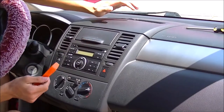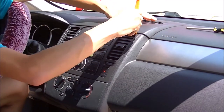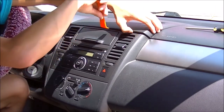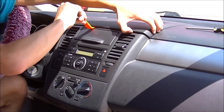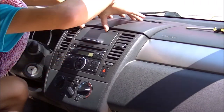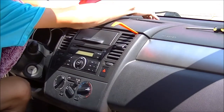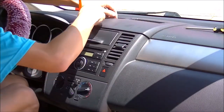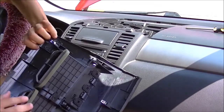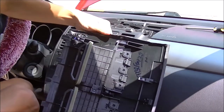We're going to pop this trim piece up and forward. Using a small nylon pry bar tool, carefully get underneath the molded foam and plastic insert. You'll hear the little pops as the clips release. Pull from the back forward to pop it out. Make sure the foam is still set in line — you may want to add a little glue to hold it in place.